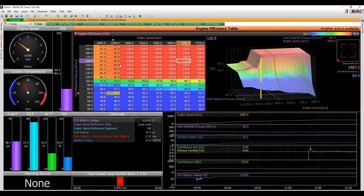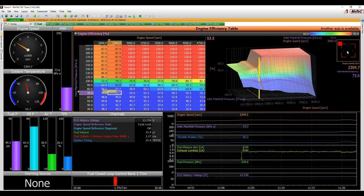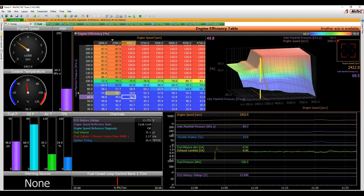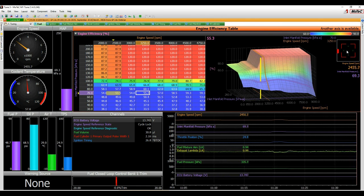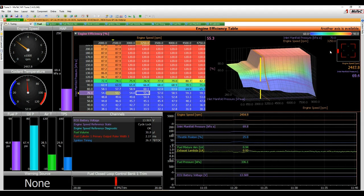It's really useful. All right, so the process is we're pushing the space bar, and you'll see over here what we're targeting is for this green dot to be in the box. So wherever my adjust site is, so wherever I click, in order to get the engine to that location, this dot here will tell you which way to go. So as you can see, if we want to get the dot in the middle of the target, the engine speed needs to go to the right.